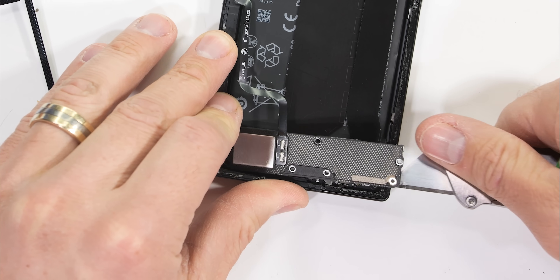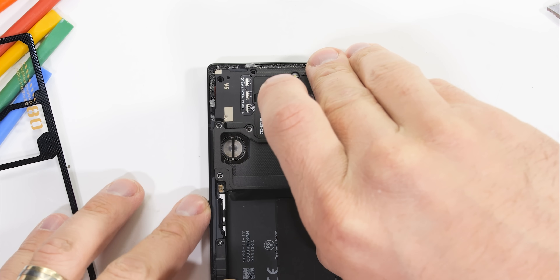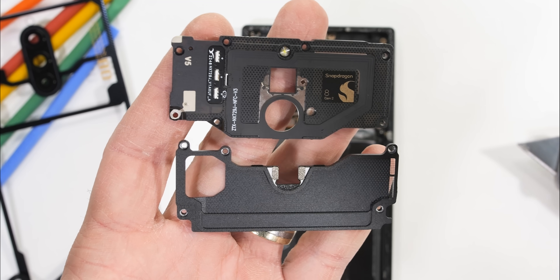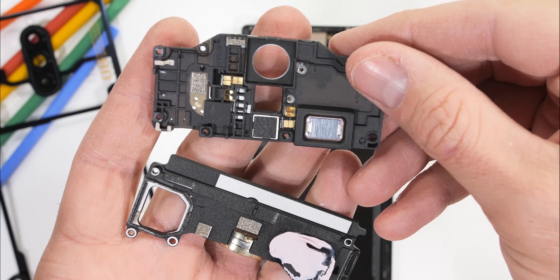When those are out, we can lift off the lower loudspeaker, which is still attached to the bottom plastics — no visible foam baffles this time around. The upper segment comes off in two parts: the top portion, which is plastic and contains the upper loudspeaker, and the lower portion, which is the air duct channel and is totally separate from the rest of the phone.